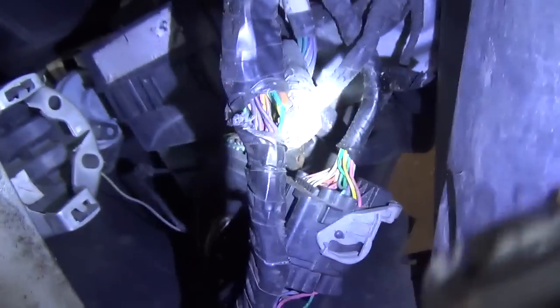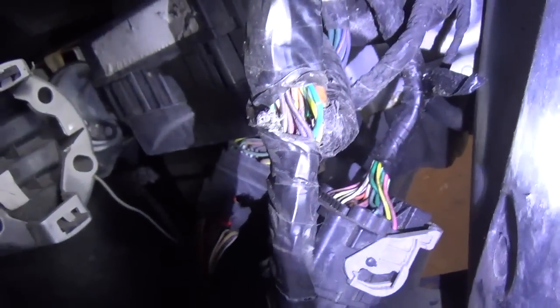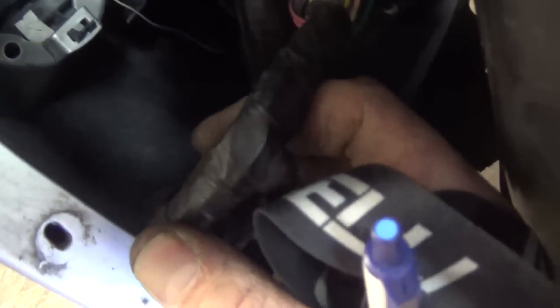This all takes time, but it's necessary. I opened it up right here and we had low voltage. Now we're really close — from here to the connector. By the time I got here and poked this hole, I had zero, or like an open circuit. I see green crusties in the OEM wiring harness, so we're going to open this up. Hopefully we'll find the broken wire.